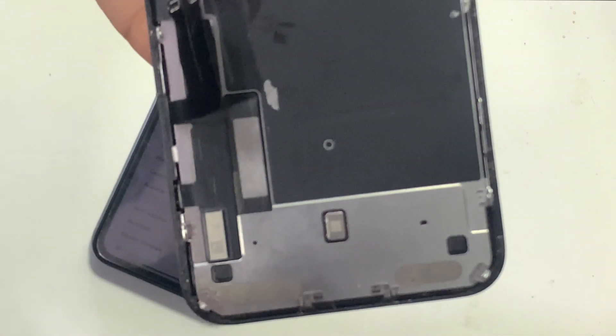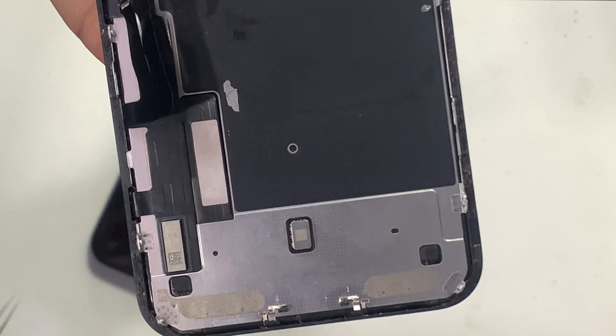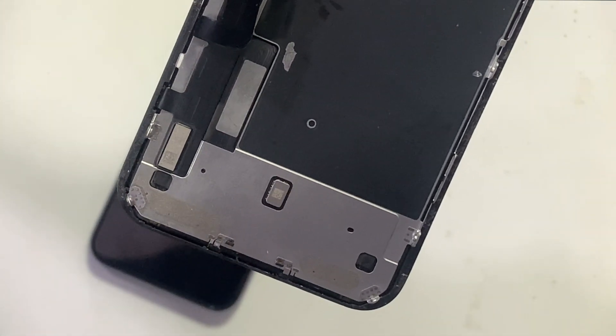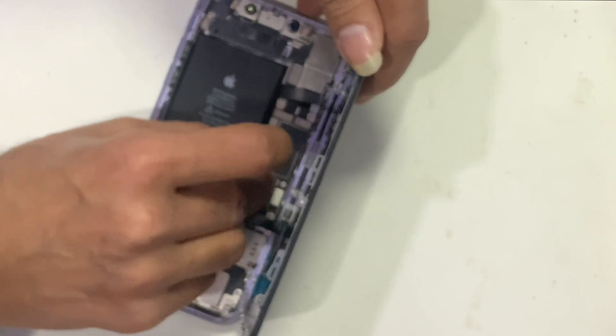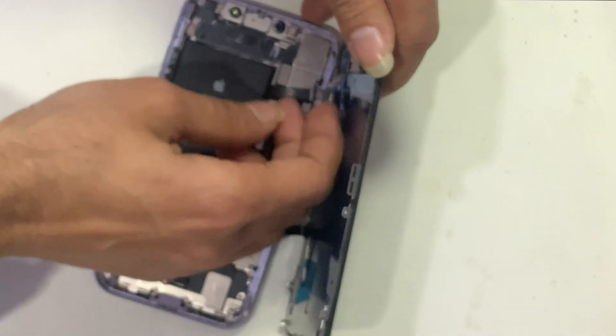This is the original LCD from this iPhone. This chip carries important data like True Tone and LCD data, and it is encrypted. When you power on your iPhone, this important display message appears on the lock screen for four days, and in Settings for 15 days. After 15 days the message remains visible on the About page in the Settings menu. If you replace the LCD, the iPhone can't verify the new screen is genuine and shows the important display message.